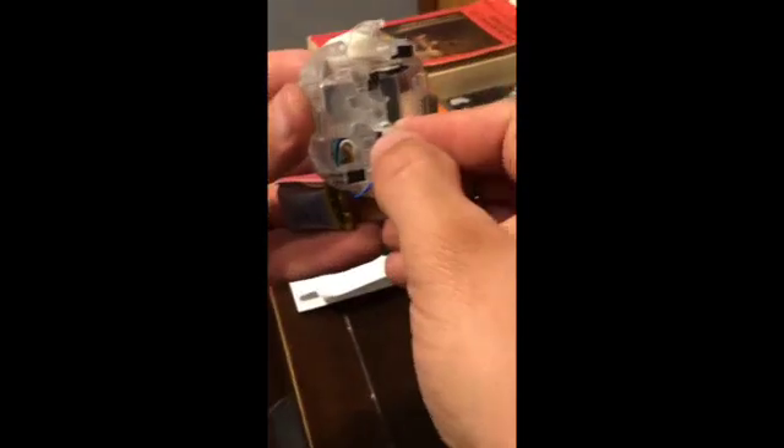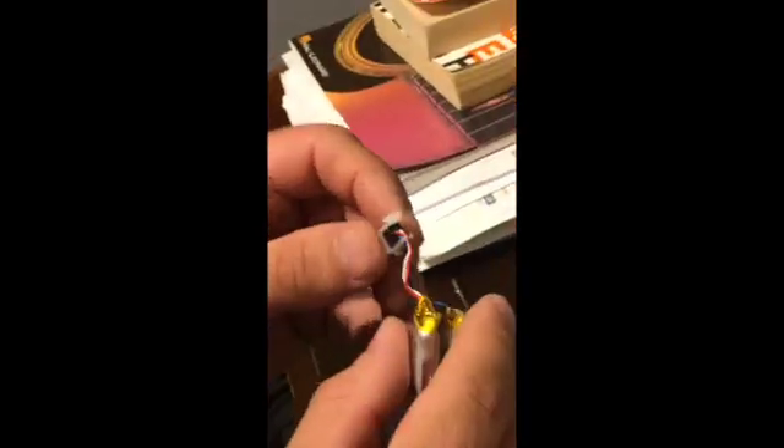You have to get this retainer clip out. It's got a little clip that's really hard to get to unless you start taking this thing apart. I used a straight pin and was able to fish that clip just enough to get it to release. When it's released, your batteries are out. Take note of your size — you can tell these are bad, look how puffed up they are. The control electronics feed into this little connector. We're going to buy new batteries and then come back to show you how to replace them.